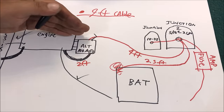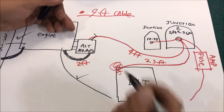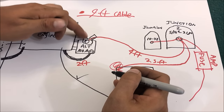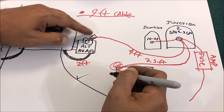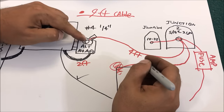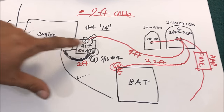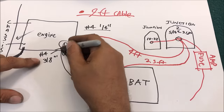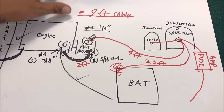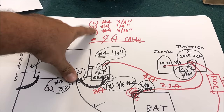Now it gets tricky - you've got to figure out what terminals you need. We're going to be using the correct heavy duty style terminals, so you'll have to go to an electrical supply store or order online. We need to figure out exactly what we need because these cost a dollar to two dollars a piece. This one is number 4 with a quarter-inch stud. We have a 5/16ths where it goes to the alternator and a 3/8 bolt on the engine block. Write them out so when you go you know exactly what to order.